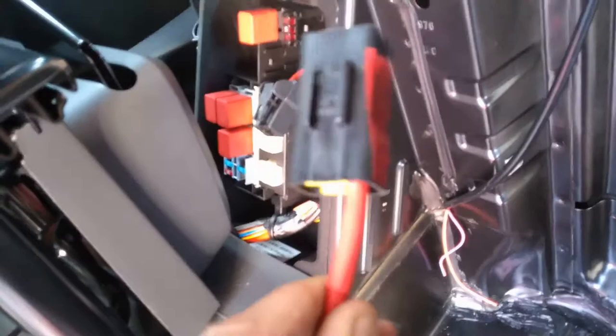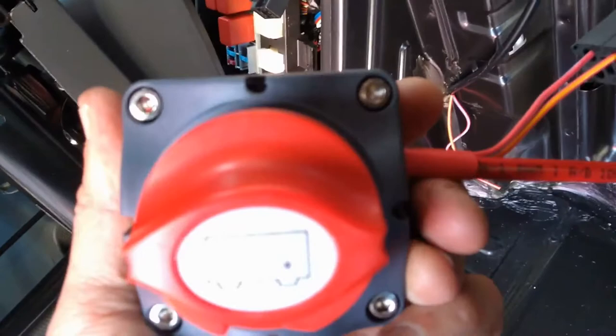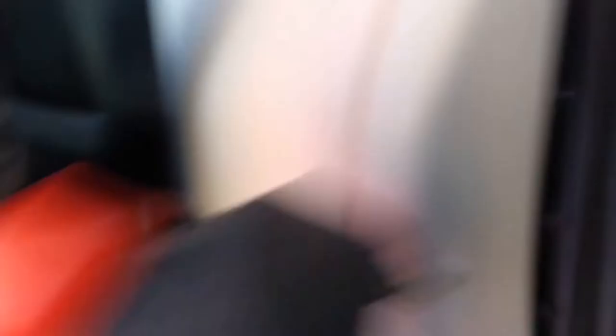So I'm going to do a job I planned to do anyway: run the power for the tow bar across through the framework and out the bottom. We've got the converter socket wired up with just a live feed — we don't really need neutral on this — and it piggybacks into the tow bar electric fuse box with a couple of fuses. This was our battery-to-battery master switch, so when finished it'll sit up here, allowing us to disconnect all van electrics with a single switch. Connecting it to live is just doing this job a bit early, but it gives us a fused live feed for the tow. After four hours of bugging around, this is the only way I can fathom of doing it.